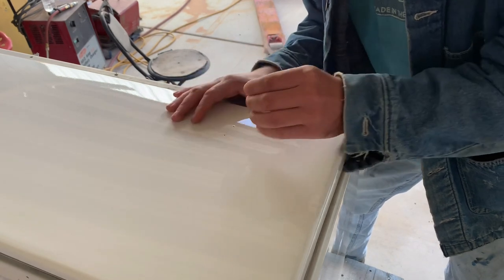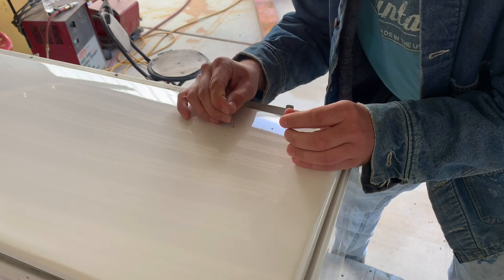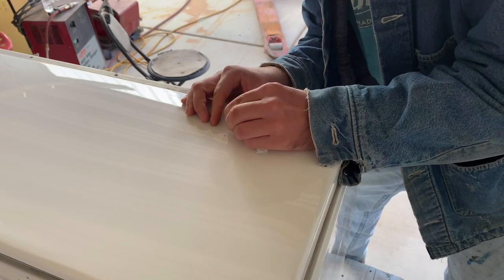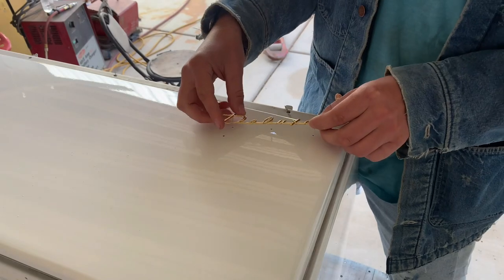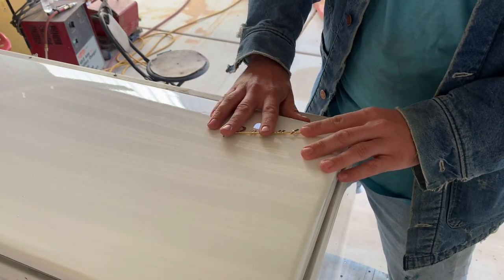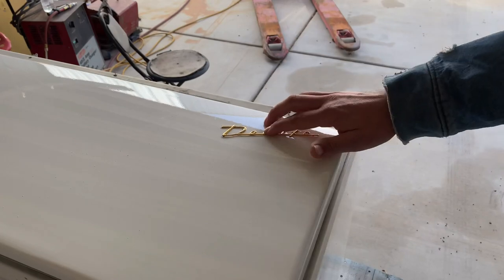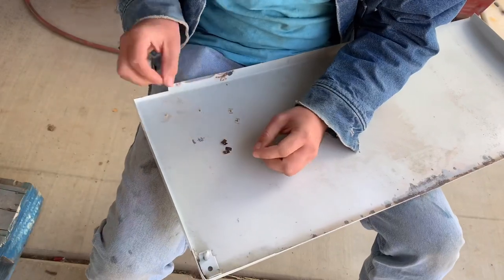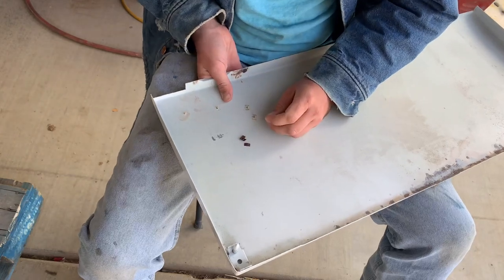It was probably the most expensive part of this entire restoration. Right now I'm running a small drill bit through these holes by hand to get them wide enough, because when you paint it, the paint has a thickness to it and gets in the holes so you can't press the emblem through. I've got to widen those holes back up a little bit, then pin the emblems in with these little clips. I'm reusing the factory ones because even the smallest ones I can find still aren't small enough for the rods that go through the back. You can see the rods that poke through and the original little clips — I'll clip these on to secure the emblem to the piece.